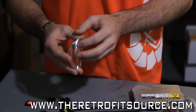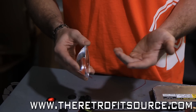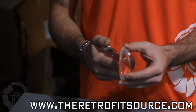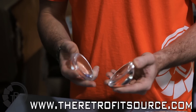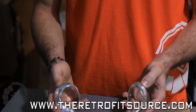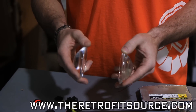In this case it's the ST-IR, which is a 27-millimeter focus. The reason why is basically because the original equipment lens from the Murano is also a three-inch with a 27-millimeter focus. So again, the first thing to do is just make sure that you get the right clear lens, because no matter how much spacing you do after that, if you have the wrong lens, you're never going to be able to get the light output right.